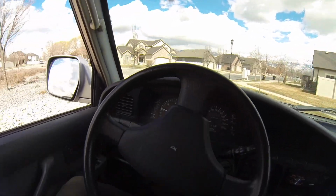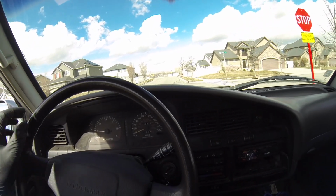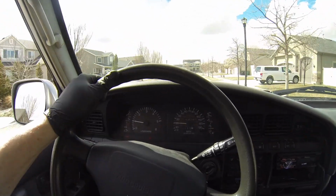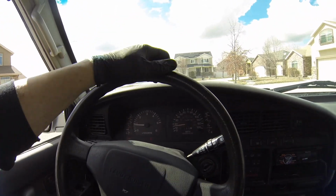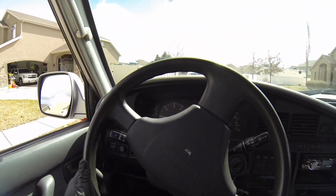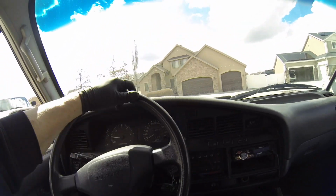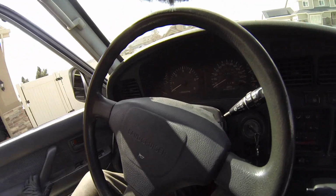The other thing is, I don't know what trips that ABS light. What is causing the ABS light to go on? Is it sensing that there's air in the ABS module somehow, in that manifold, so it can't do its thing? I don't know enough about ABS. I think we're just gonna try to bleed the whole system. We're gonna start at the master cylinder, make sure the master cylinder's bled, and then we're gonna bleed right after the ABS module. And we'll do all 4 wheels and the load sensing valve again. I think that's gonna be the plan, and we'll see where that takes us. I was hoping maybe just that load sensing valve would do it, but I kind of knew that wasn't going to be the case. All right.